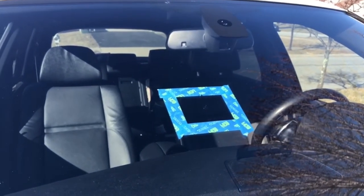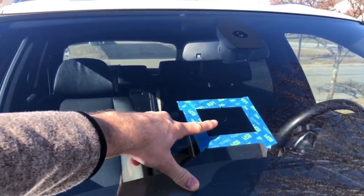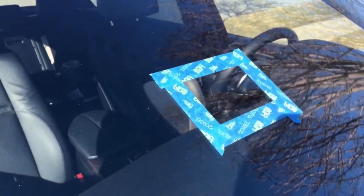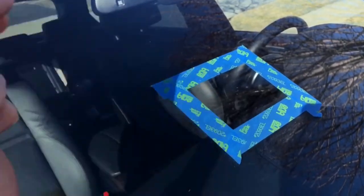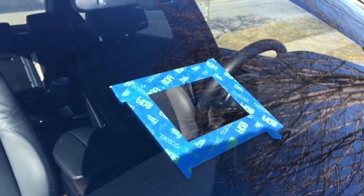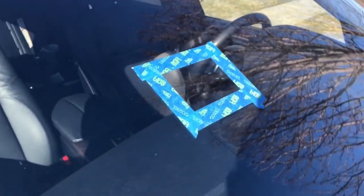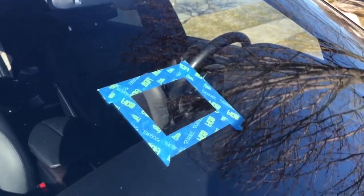It's been about 25 minutes. I peeled the film off and cleaned everything up with the blade, then use an alcohol pad to clean everything off the windshield — any extra mess you made. Look at this — what a difference! Those three little dots are not cracks anymore. I left some residue on; I'll clean it off after the video. Definitely thumbs up to this product — this will prevent any further cracks. Hope this helps you on how to repair your windshield!